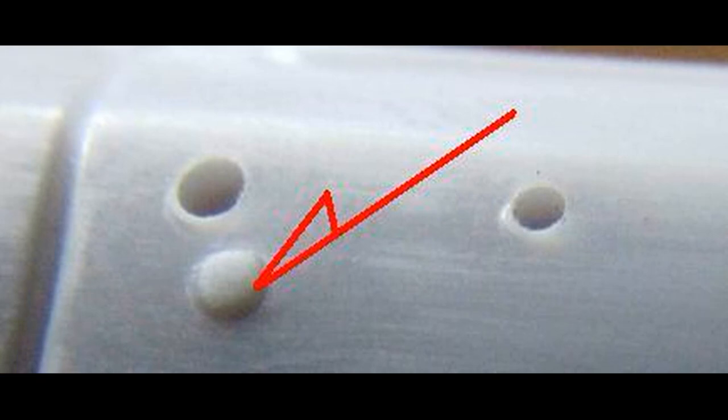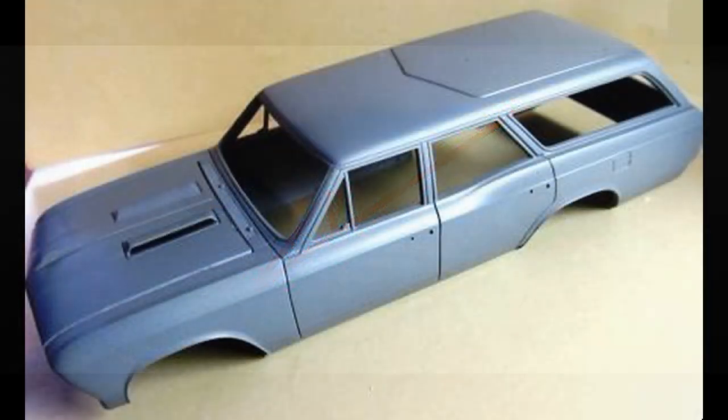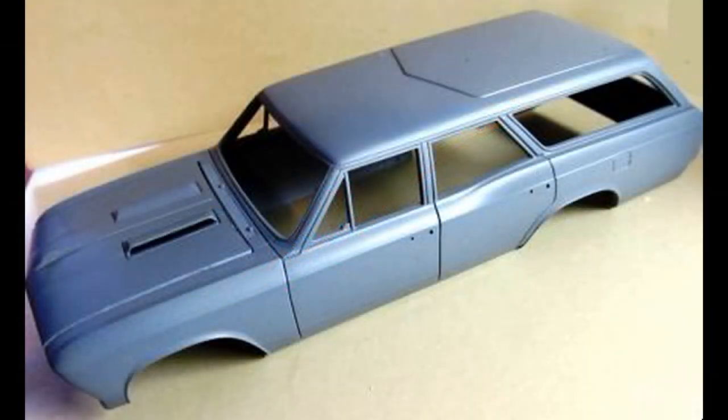And then you can remove the door locks off the front doors too. You replace those with decals as well. Now tape the hood into place and spray the entire body inside and out with a nice etching primer, and then look for any blemishes that you need to address before you add your paint color.